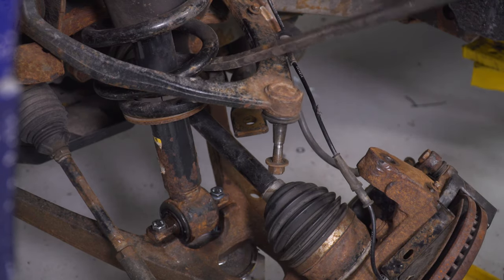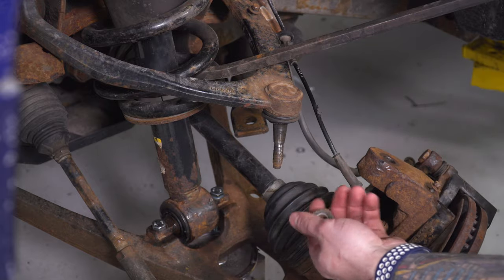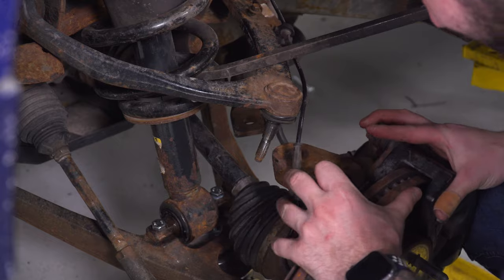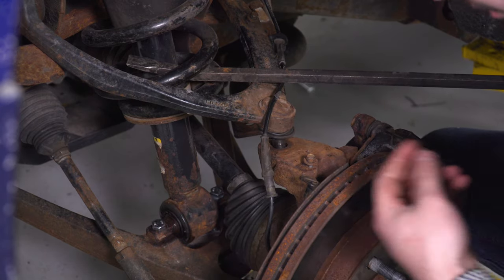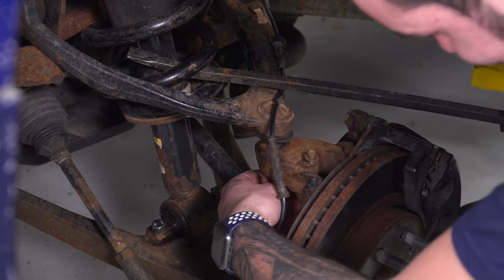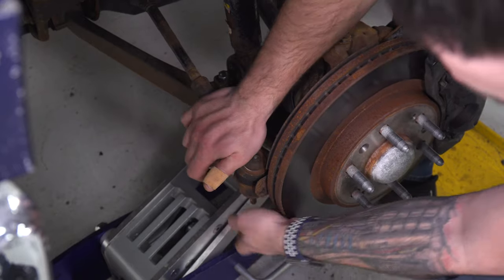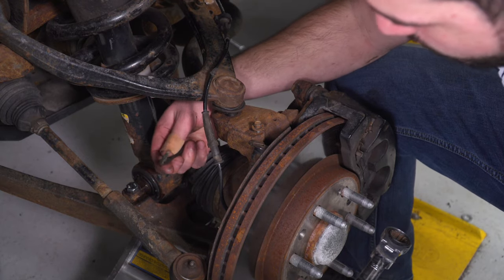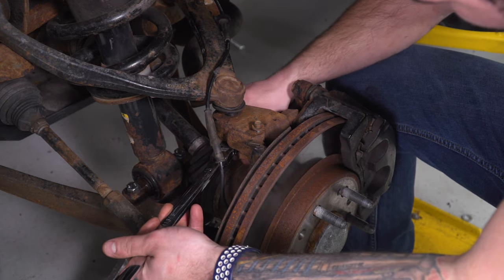Next up, we're gonna focus on our upper control arm. I'm gonna put a pry bar on top of it underneath the coil to help pry down. I'm gonna take this nut off, lift up the knuckle, set it into place, pry down, and put the nut underneath. I have a jack underneath for our lower control arm to help push that upward so we get enough threads underneath. Then we can tighten that down. In order to prevent our upper control arm ball joint from spinning, I'm gonna set our tie rod end into place to hold the knuckle steady, put the nut underneath, then tighten down that upper control arm nut using an Allen key in the tip of the stud and an 18-millimeter ratcheting wrench.